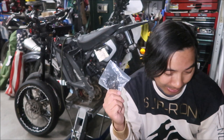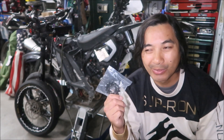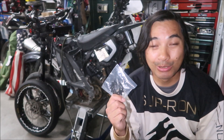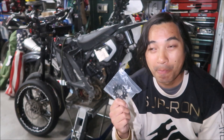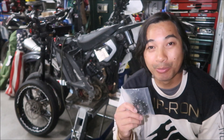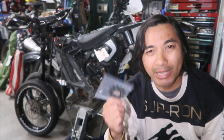There's a 14-tooth stock size and a 15-tooth option if you want higher speeds. When you go up a tooth on the front sprocket, it's like removing about three teeth from the rear sprocket. So if you have the 15-tooth and you're running a 48-tooth rear, your bike is going to run like a 45-tooth rear — geared for higher speed. Be careful though, wider gearing puts more strain on your motor and increases your chances of burning it up. Stock gearing is perfectly fine, so I chose the 14-tooth sprocket.